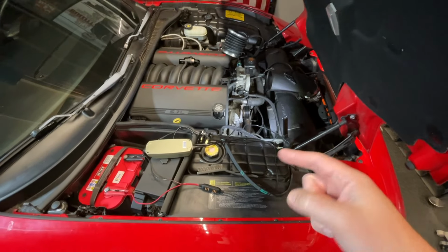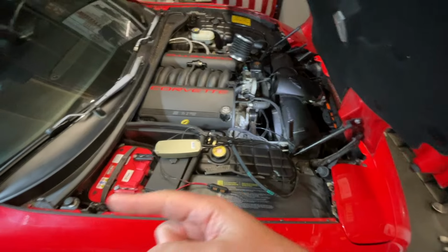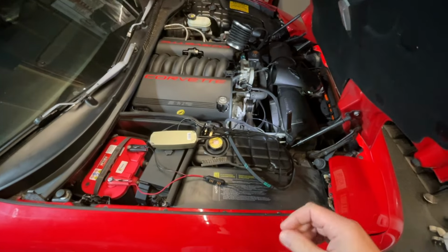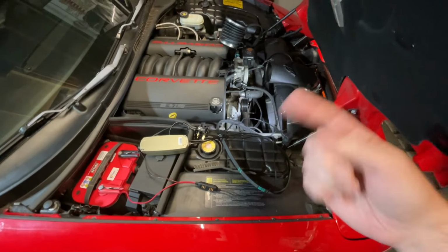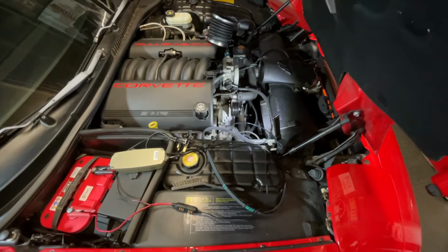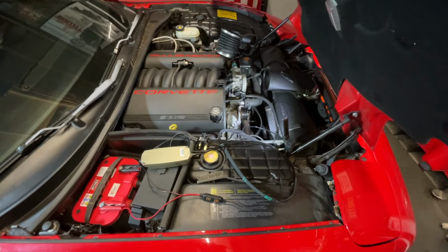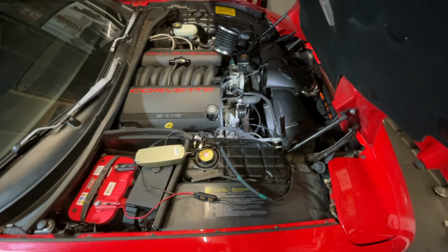When I put the tyres on, I obviously took the car out of the garage and reversed it back in. That little bit of a load from reversing it back in caused the engine to high-pitch squeal. So I tested it out a little bit, came into the car, revved it, set it at 2,500 RPM, and yes, it squeals like a pig.